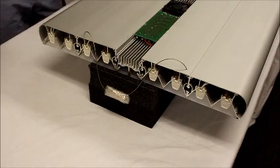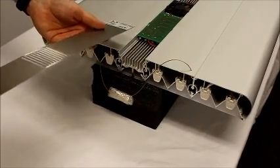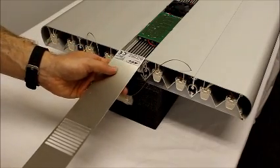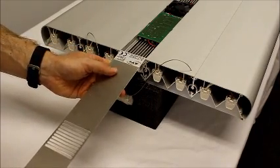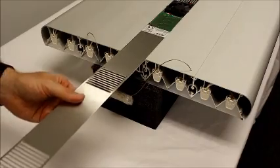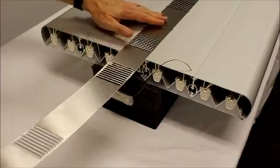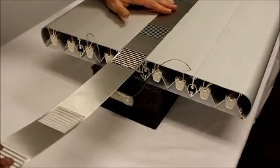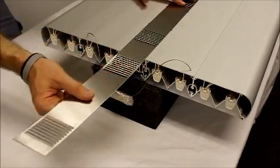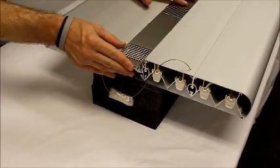Next, put the metal plate back into the middle of the fixture. You want the label side of the plate to go towards the lamp cord side of the fixture, and it goes in the top groove. Work it in with both hands — support it, as it's a little flimsy and can bend. As you're sliding it in, be really careful to make sure you're not catching any of the wires on any of the KSQs or fans. It should go in pretty easily and slide in nicely. If it does catch, make sure you're not catching any wires, KSQs, or fans.